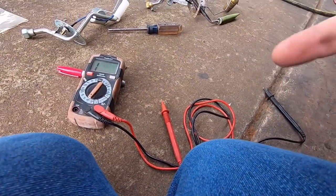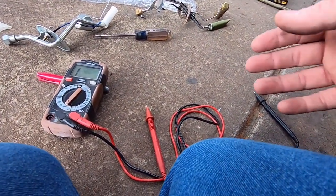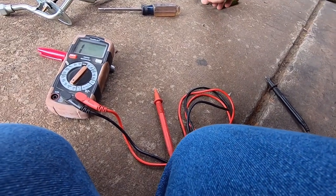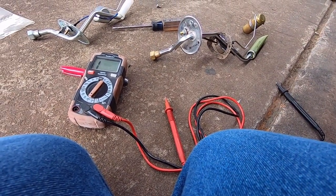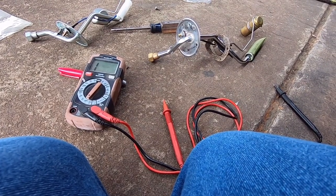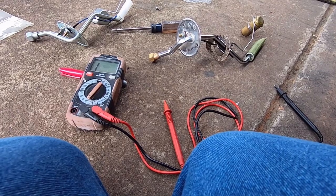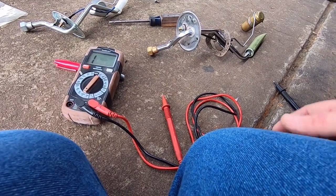When I was talking about a ground - if you've undercoated or bedlined your car, your body won't get a good ground. Basically your gas tank acts as a ground - it's grounded out through metal-on-metal contact to the body. If your gas tank can't get a good ground to the body, you'll have to put a jumper ground on it.